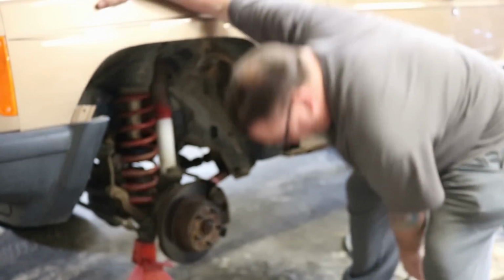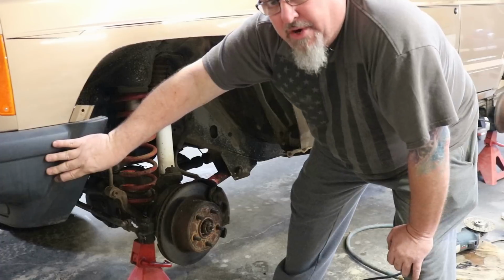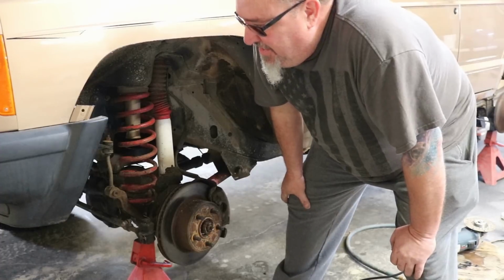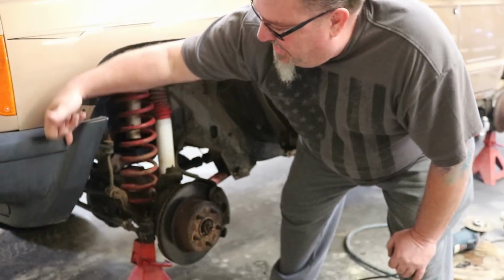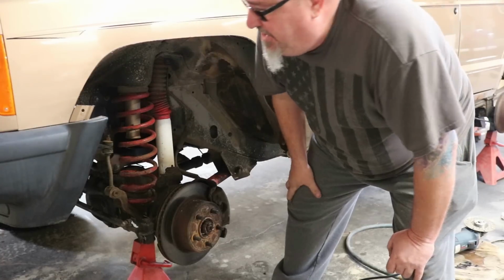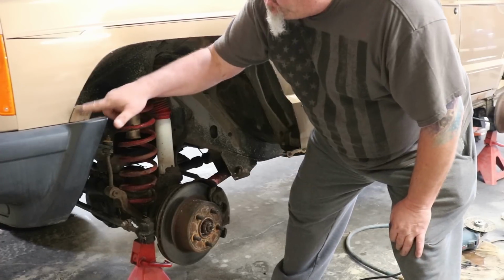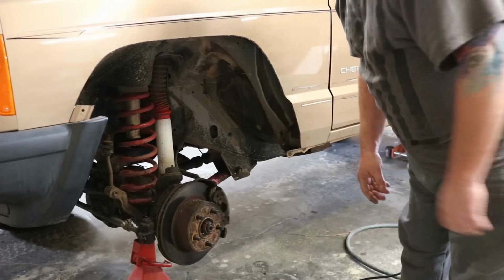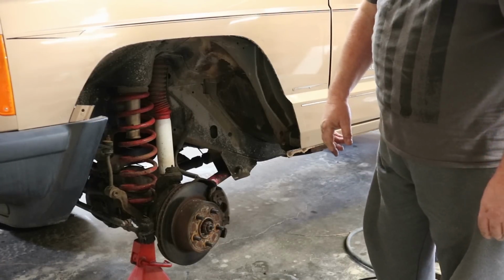I see guys online and on the internet, you'll see a lot of trimmed fenders and they took these bumper caps off. And you can do that and the room is there, obviously it's just a piece of plastic, but it sure looks better with that on. And we're just going to cut that right down under there and take that strip out of the way and just make more room, but it can still look good. You don't have to yank that off of there and ruin how it looks at the same time. So I'm going to get this little piece out of here and trim this down here, and we'll start doing some trimming on the bumperette end covers, and we'll be ready to lay down some paint and trim, and this project will be ready to go.